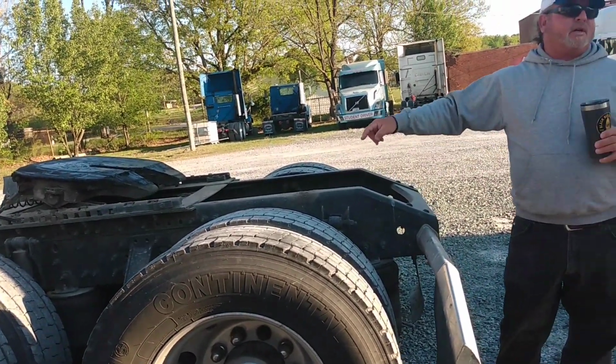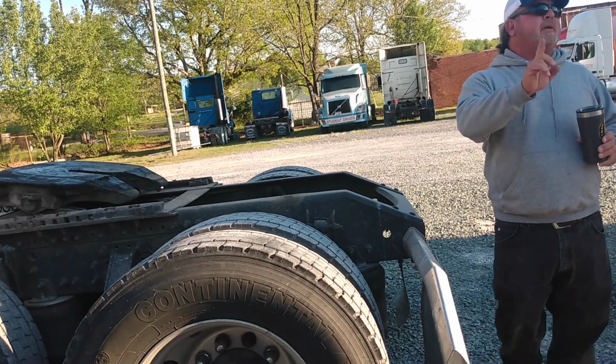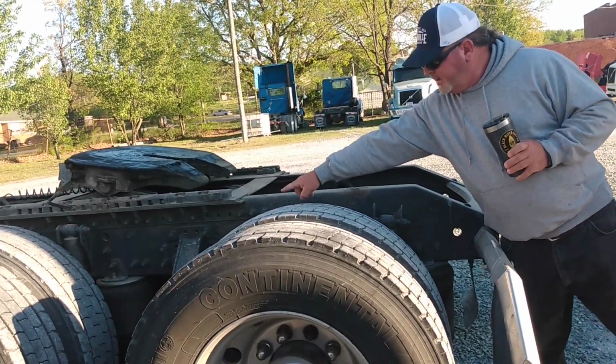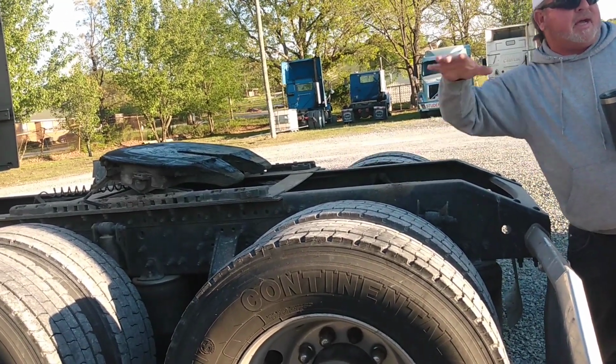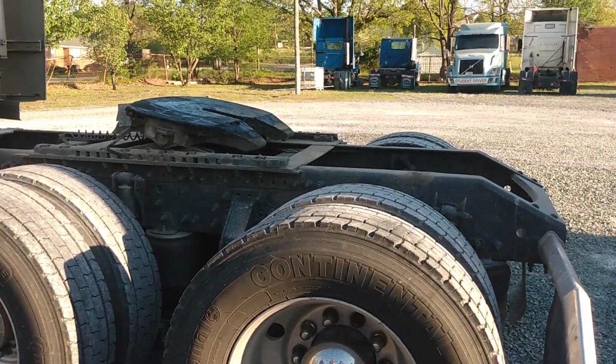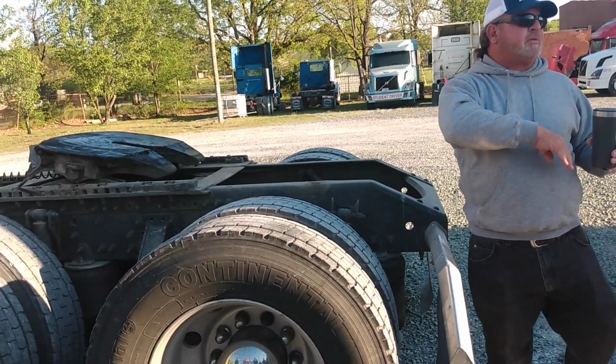The one we're looking for here today has got a picture of a truck with an arrow up and down. You just push that button, and if it don't stick, it lets the air out of these airbags. Lets it down so that it takes the jolt off them landing gears, right? We used to just let them always slide off the back.